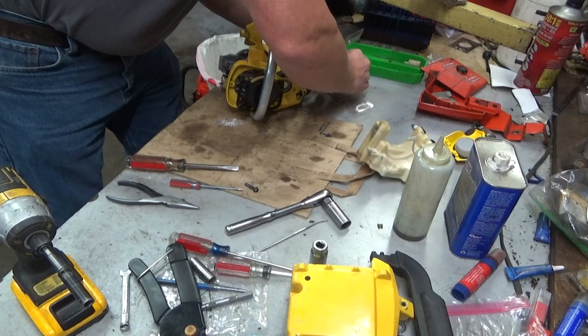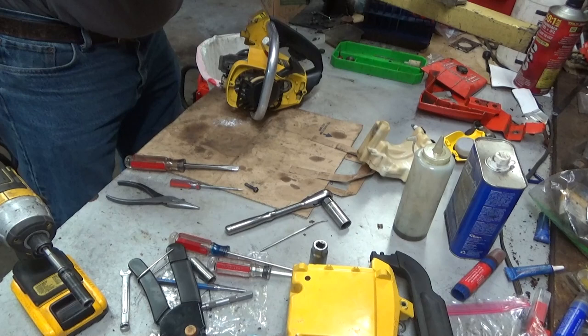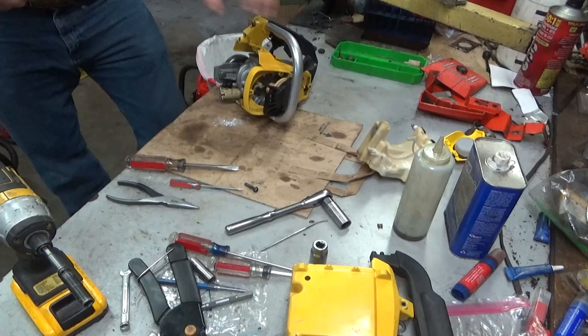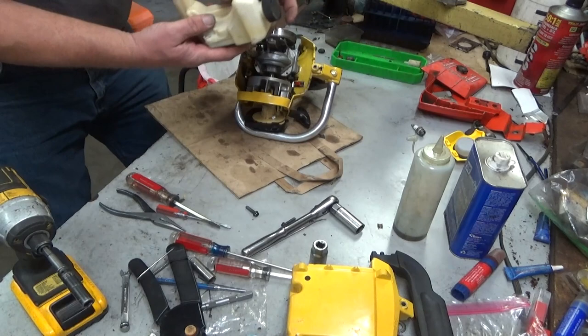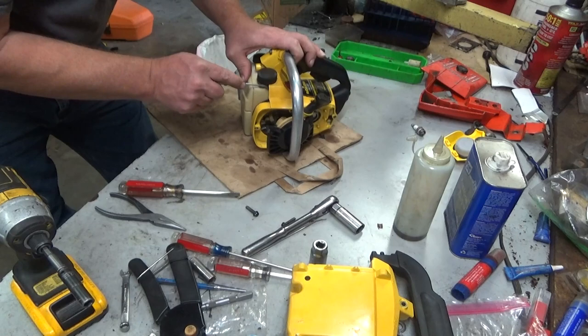Is to knock that tang off the end. They've got it set up so that tang is brittle and it'll pop off pretty easy. And if you don't break it off, it actually bends down and jams up the screw a little bit. That's it. Right there. So, let's go ahead and get rid of our metal shavings. Can't quit screwing around here and get a test run going. A test run that ends well.